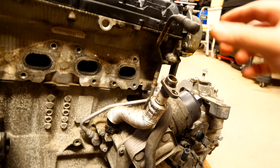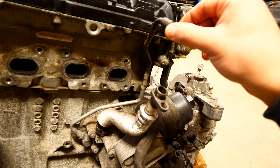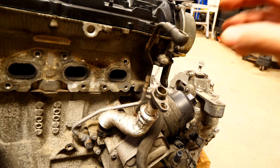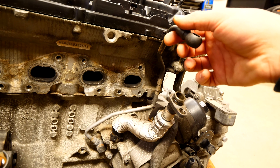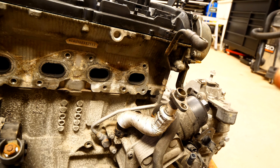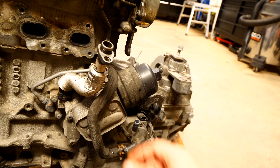It is crucial to replace these with new pieces whenever you're doing this process, since both of these lines are notorious for getting oil buildup on the inside of them. You don't want that to flake off and clog up your turbo and starve it of oil. By spending like 50 bucks or whatever it costs to replace both of these lines, you're going to be doing preventative maintenance and making sure your turbo is well fed with fresh oil and fresh coolant.